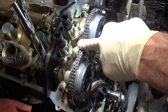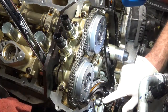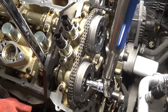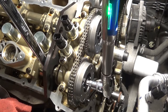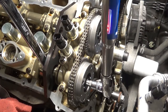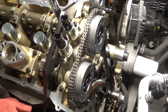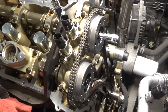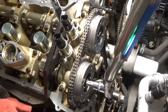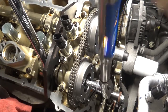I'm going to let it go back counterclockwise and the tensioner will push out — simple as that. Just make sure your finger is down on that little clip to confirm it's loose. Then tighten these bolts; they are tightened in three sequences. The first sequence is 30 foot-pounds. Use the wrench in there — I don't want to apply force on the chain, the guides, or the tensioner, because there is slop on that cam locking tool. The next step is to loosen them up 360 degrees.